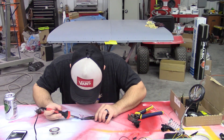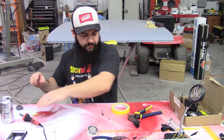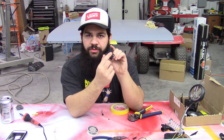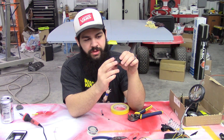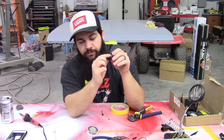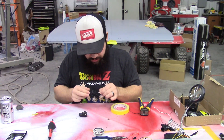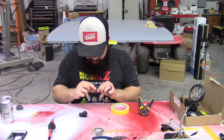Now I've got the wires connected to the sensor. It's time to connect them to the plug. When you look inside, you've got three spots that connect to your plug on the outside — again, this will be on the diagram in the description. The outside one is where number two goes, the inside one is where number three goes, and the farthest outside one is where number four goes. I'll post some solder on the wires, post some solder on the connector, then heat them up and get them to stick.